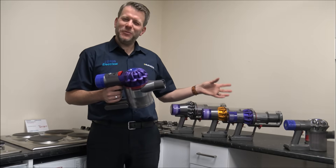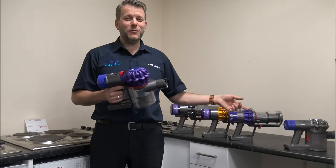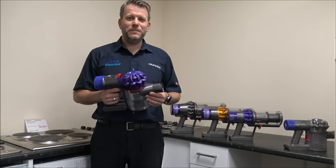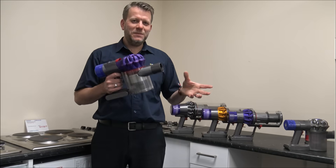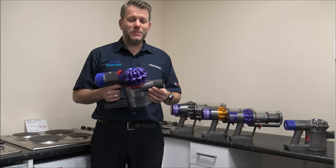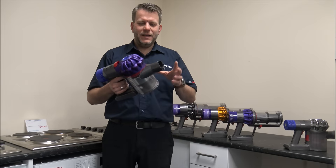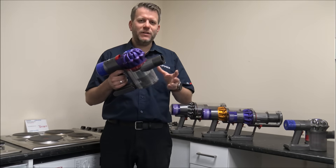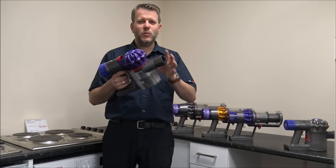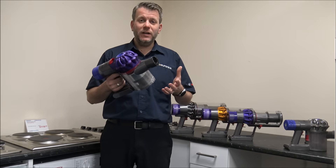Having all the Dysons here together is almost like a bit of a family reunion, especially with the old V6 — it's one we haven't sold for several years now, but I managed to find one for this video. What I want to do is show you how simple it can be without having to call an engineer or Dyson themselves, because normally it is something pretty simple. The reason it's making the pulsing sound is the vacuum's way of telling you it's got restricted airflow through the system. It's a technology designed within the vacuum — it's a good way of saying that somewhere along the line we have a blockage.